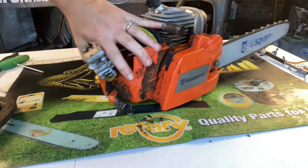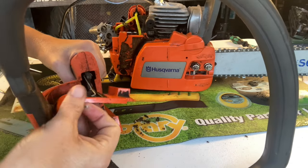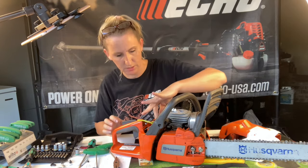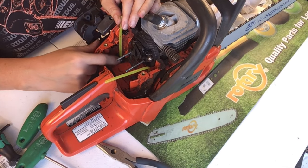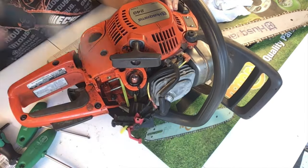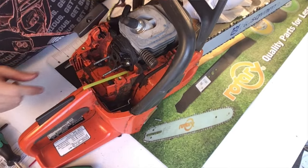You'll just have to remember how to put it back together. If your throttle linkage comes out of the trigger, you'll need to remember that it needs to go in the slot that way before you mount it back up. We're going to set the carburetor aside because we're going to show you how to put the kit in in just a second. Even though it's got the new kit, there is a grommet down here — and this is what leaked on me. So we are going to remove the new fuel filter and line that we just put in today, set it aside, and take this grommet out.